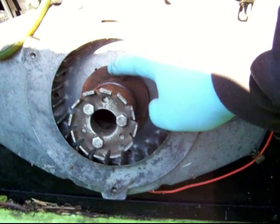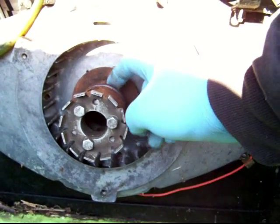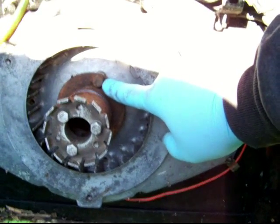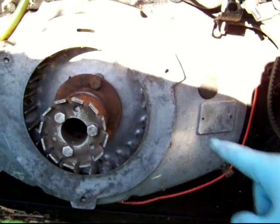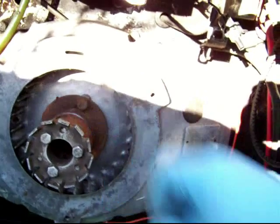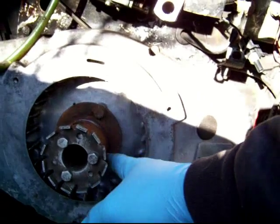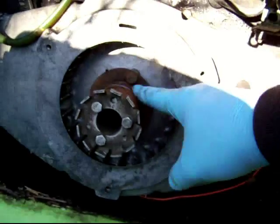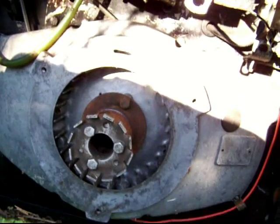So an open end wrench works better here. Otherwise, just getting it loosened up with a socket is helpful, and then finish up with a wrench. And then the eight screws to get this cover off. So eight screws, three bolts, will have access to the flywheel nut that's hiding under here, and then put the flywheel puller on. We're almost there.